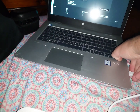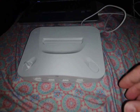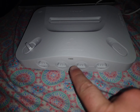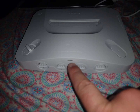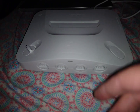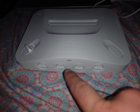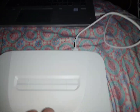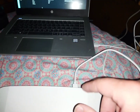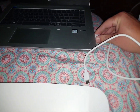I did get this to work earlier, but I'll show you what happens sometimes with this USB-C to USB-C cable. Sometimes when you use the USB-C to USB-C, it just keeps on flashing and the fan comes on for a second and then it goes into kind of a loop. So you don't want to update or try to access the SD card when it's doing this. If this is happening with your console with the USB-C to USB-C cable, just don't worry about it — just don't use the USB-C to USB-C cable.